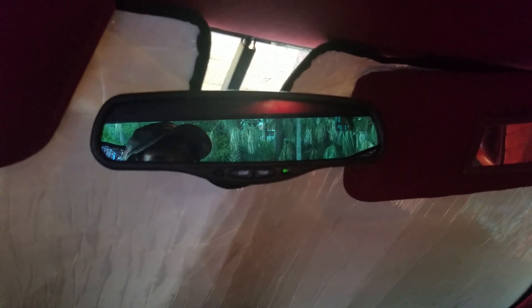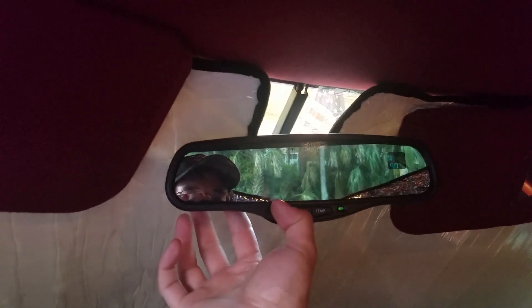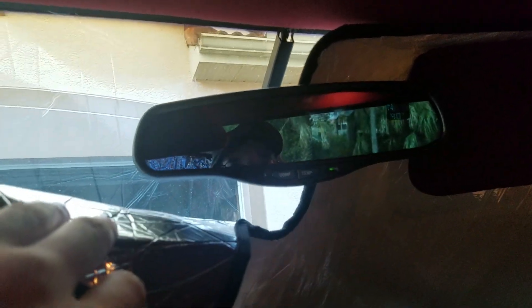Every time now — it used to reboot and everything was all messed up. Belt's making noise — I think it's rust on my belt. 91 degrees, that's about right. North now — that's correct. The compass is working. Let's check — maybe it'll get darker if I do this, or lighter. You see the light sensor? It should darken up — yep, it thinks it's dark time. If I open this up it should lighten up, because the windshield tint and all these shades in this truck mess with the light sensor. There's the light sensor — lighten it up. So that's working perfectly.